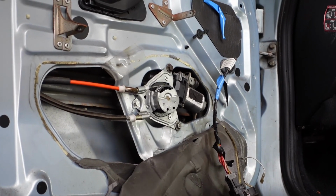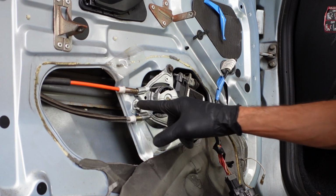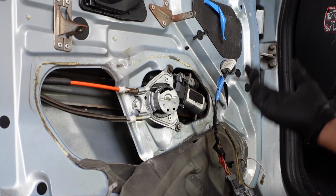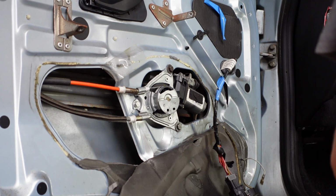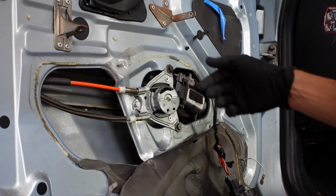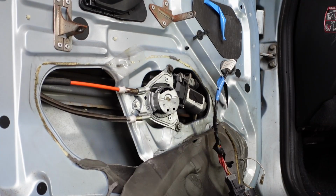There we go. So there's 3 fixings for the motor. Usually they are rivets. So you just drill the rivet out, you replace it with a nut and bolt, or you could use nut certs, which I've got here somewhere, which I was planning on doing anyway, which are these, really handy, or you just nut and bolt it. You can get behind, so that's just fine.